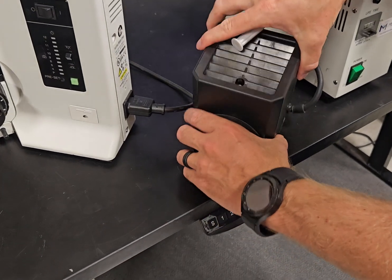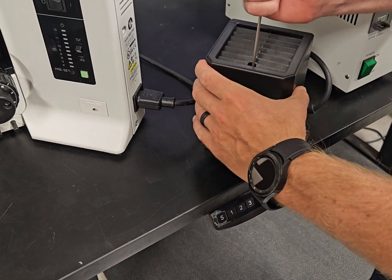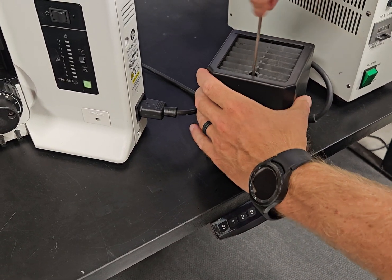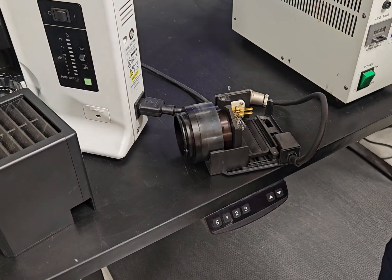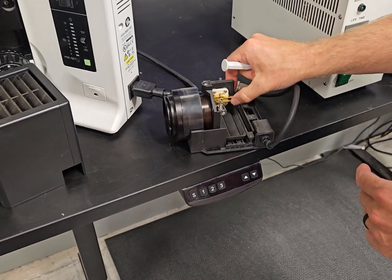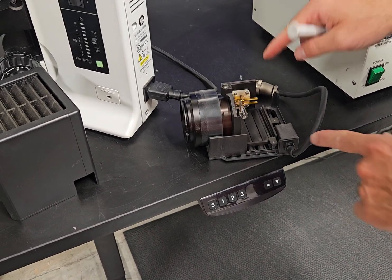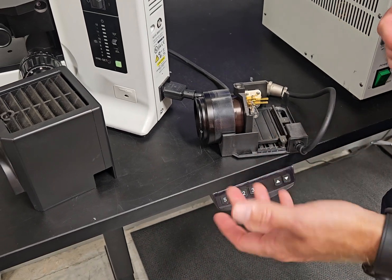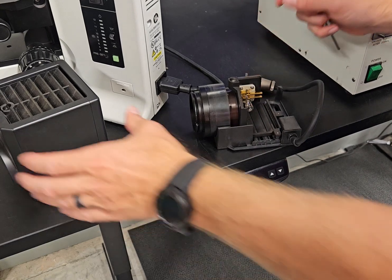To change the bulb, there's a little screw right there — same wrench that does everything. Back that screw off, it lifts right up — there's your bulb. That's your halogen bulb; if it goes out you can change it. This is a 12 volt, 100 watt Osram. You would just push this down and pull that out, put the new bulb in. You never want to touch the bulb — I don't have a glove on right now, I'm just showing you the example — but you push these two prongs down and then you take the bulb out.